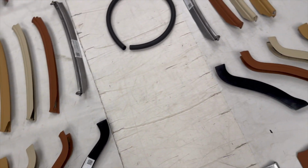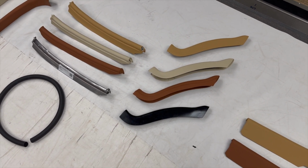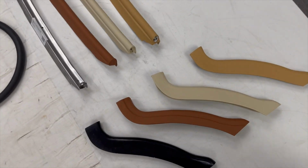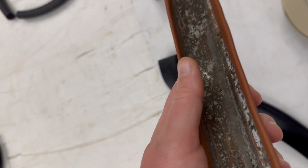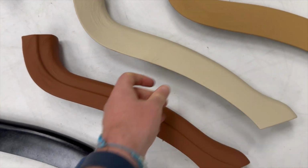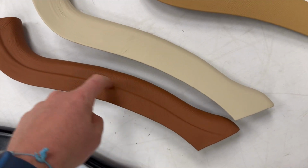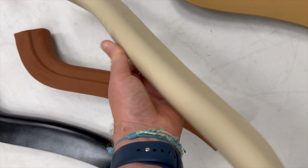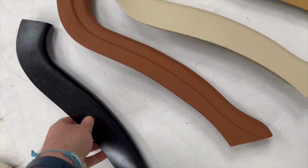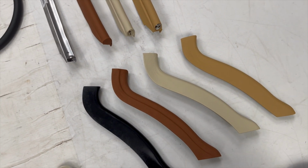Then you've got the quarter elbow cappings, or the dog legs as some people refer to them. Again, they did differ between the cars. The TR2s and TR3s tended to be one style, and then the 3As another style here. Same principle again, we've got an original TR3 there, then we've got an original 3A, and that's perfect actually because you can see the differences there. The TR3 had a groove down it, whereas the 3A didn't. And then the aftermarket, which is this Biscuit one, is fiberglass without a groove, so just bear that in mind again. But again, please do see the video at the end of this one, which goes into a lot more detail.